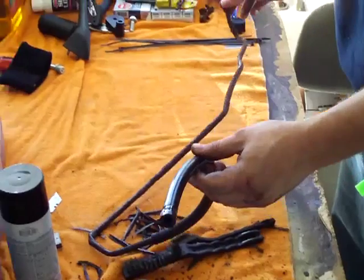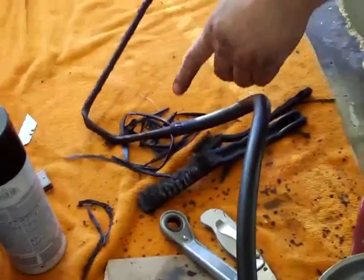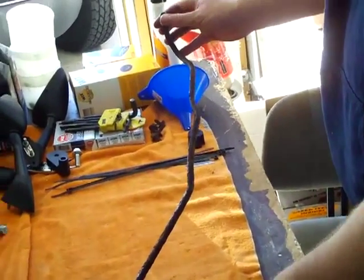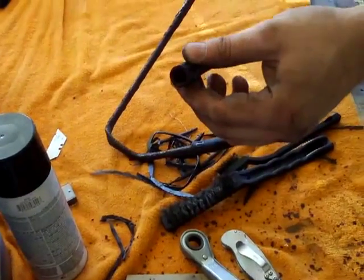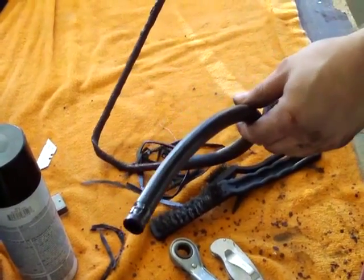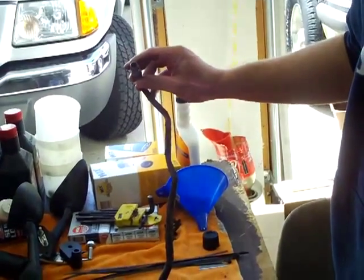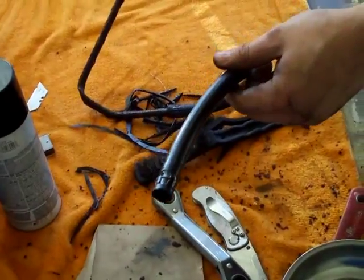I ordered a fitting for the radiator and we're just going to run a rubber hose the whole way. Here's the trans cooler line — for some reason they use half rubber hose and half aluminum hose with two clamps holding it on. This just pops right off of the trans cooler, and this side goes into the bottom of the radiator. I bought an adapter so I can run rubber hose all the way rather than having to bend aluminum hose.